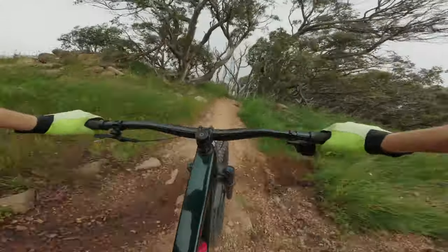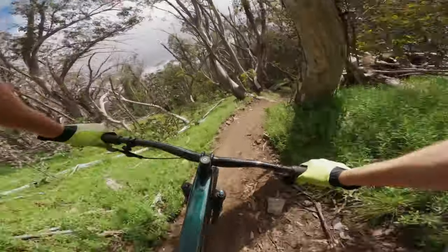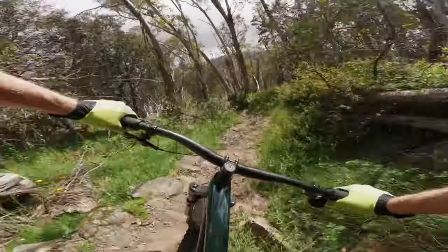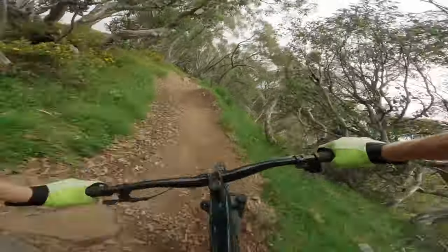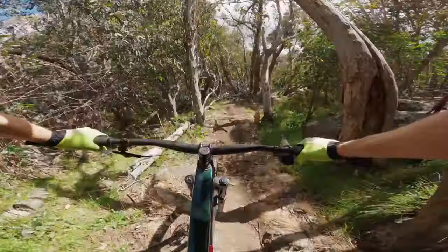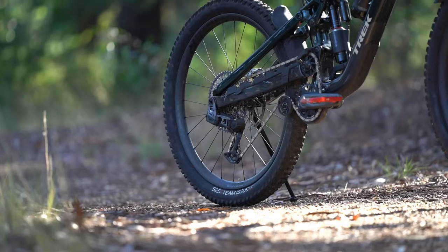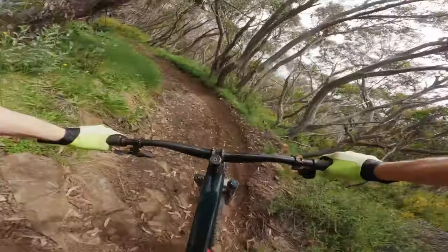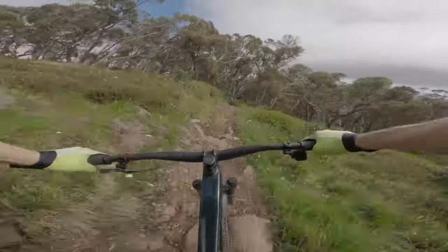This is a seriously good descender. It's got great stance on the trail and you feel very centred within the bike. The RockShox Vivid is genuinely impressive, offering a level of sensitivity that isn't that far off a coil shock — supple over small bumps and chatter, with excellent rear end grip. Trek's high pivot suspension design has to be commended too. It eats up square edge hits for breakfast and the neutral anti-squat and ABP platform means the back end is unencumbered by drivetrain or braking forces, helping the Slash flow smoothly through chunky rock gardens and across high-speed braking bumps.